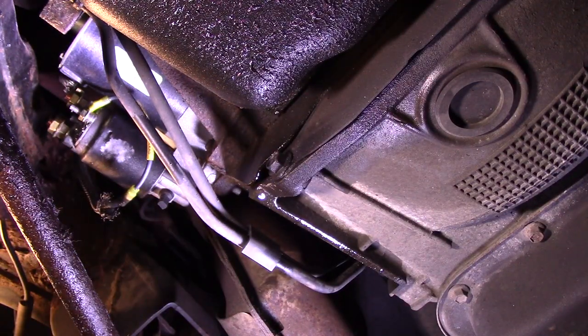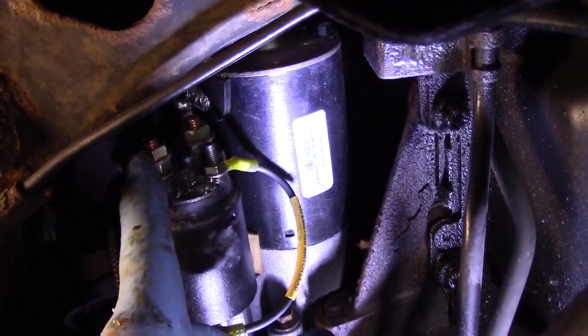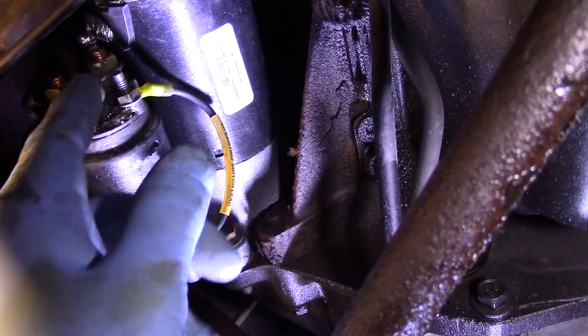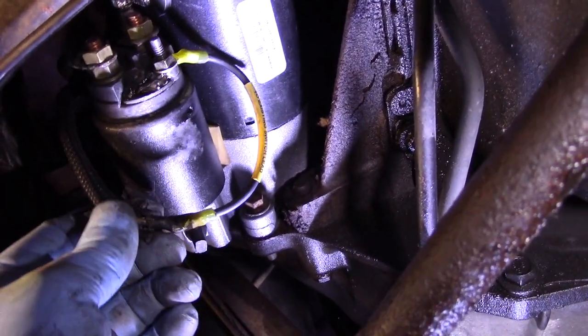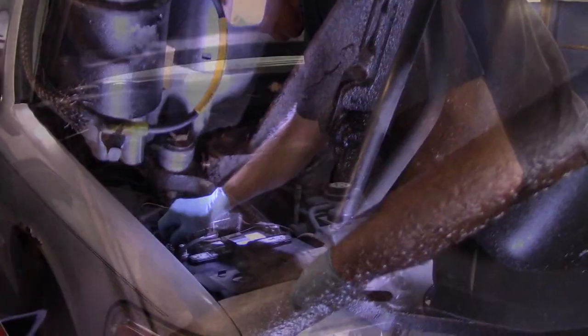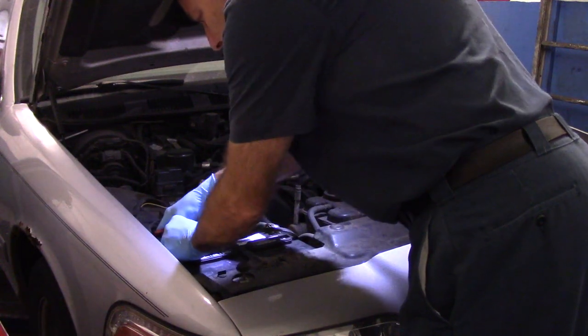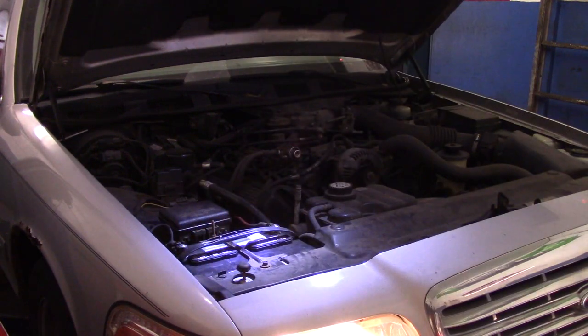Let's review what we did: all three mounting bolts are tight, the main lead is connected and not touching anything inside, and the new start wire is crimped and heat-shrunk. Let's lower it down, connect the battery, and start it up. The battery is brand new so there's no oxidation to clean — just tighten it up. Job is finished and out the door — it's not even 8 o'clock. So we'll see what today holds for us and what I can film. As always, thanks for watching, see you on the next one.